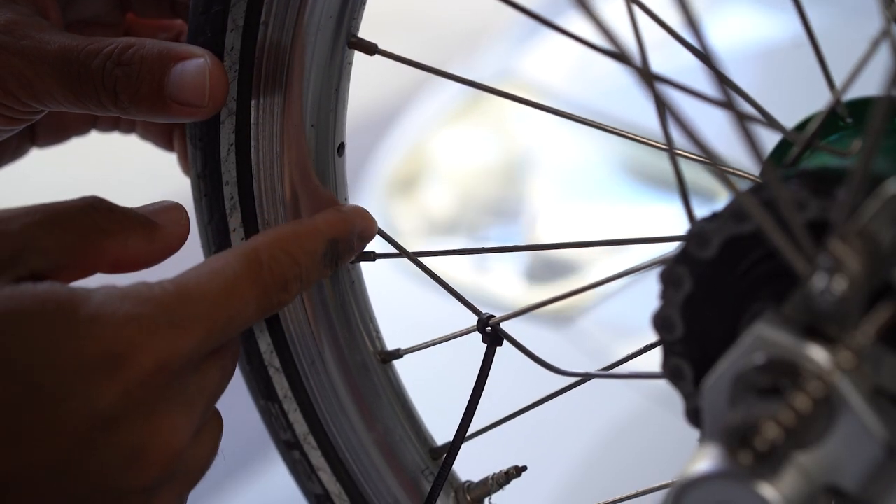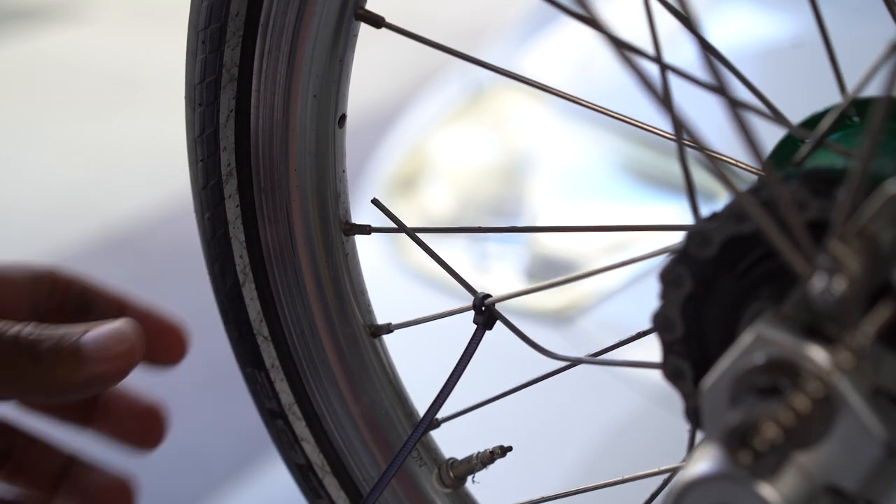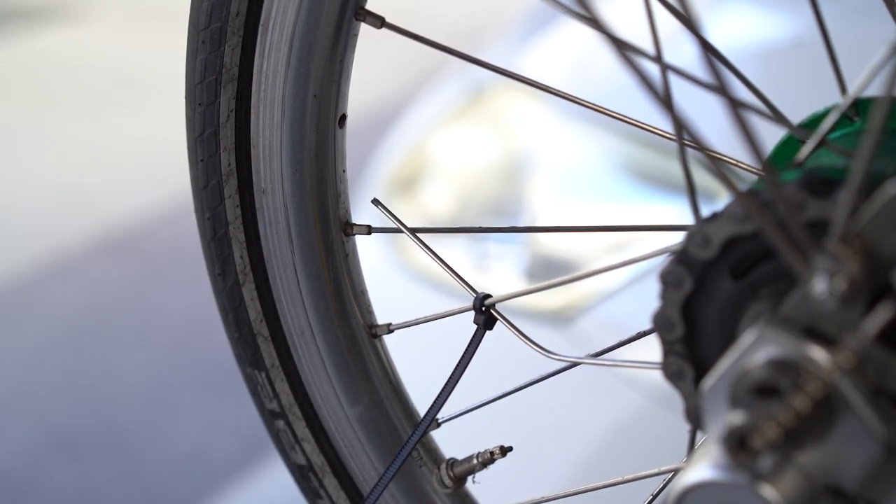As for the other spoke, the nipple had actually snapped off from the spoke end and was already inside the rim — rattling, very displeasing. That spoke I couldn't remove from the rim because it was stuck against the sprocket. So in my rescue pack I had a little zip tie, and I used the zip tie to secure it against a fully functional spoke — just leaned it against it and tightened it on. I didn't have a cutter with me, so the end of the zip tie was rolling around, but I could still ride the bike home. The lesson here: in your rescue pack, alongside spare tubes, inflators and all that stuff, it's good to have a few zip ties. They will rescue you at the worst moment on your bike — a must-have in your rescue pack.